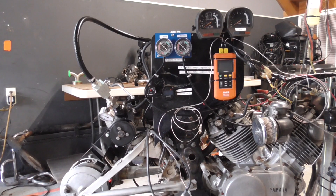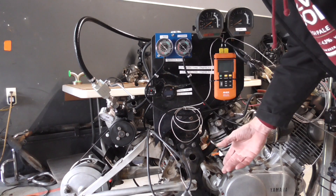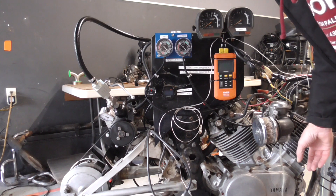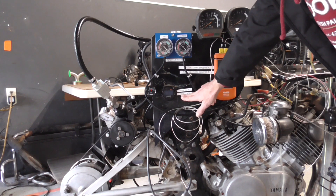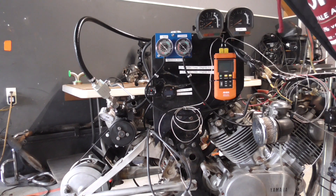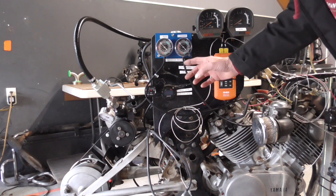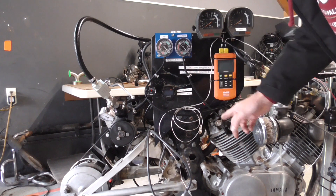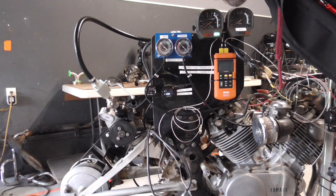We're all set up just like normal. We got the rear cylinder leading in the timing, which is the way we normally set it up. Then it makes a short rotation on the flywheel and then the front cylinder fires. I'll show right here that this front cylinder is running leaner. Now this is good enough — I could tune it in. I haven't tuned the carburetor yet, just got it running, but it's close enough. I want to see while it's in balance like this, what happens if I swap this timing around. We'll fire it up and you can see once these come on.